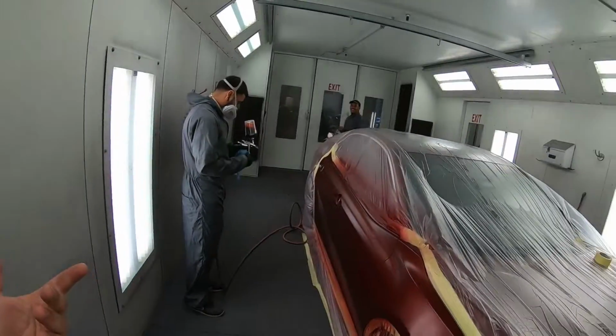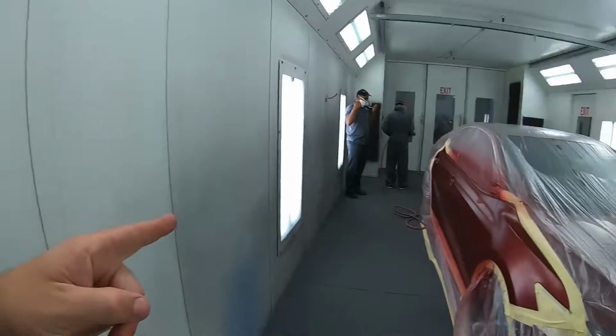So the process he's gonna do is a reverse blend, right? That means he's gonna take the blend as far as he's actually gonna paint, and then the next steps are gonna be within that blend. The candy going on? Yeah. So he's going to spray it at medium wet. It's not going to be perfectly glossy, but he's going to spray it wet enough to the point where it's going to look very uniform. So let's watch him do that right now.